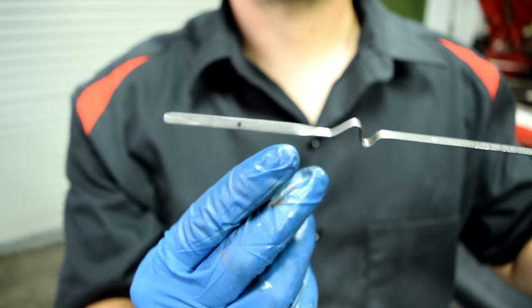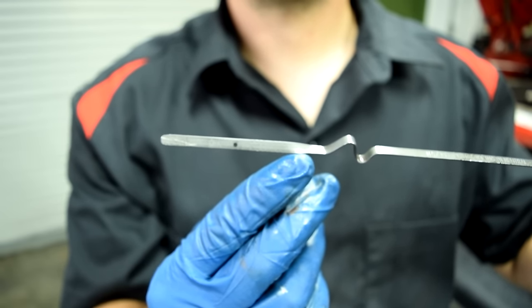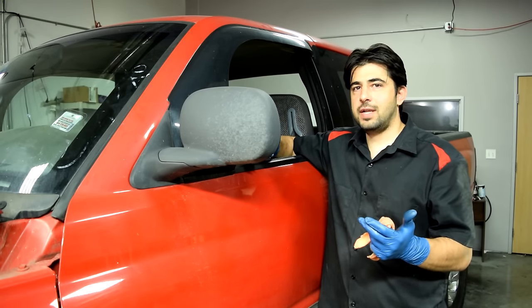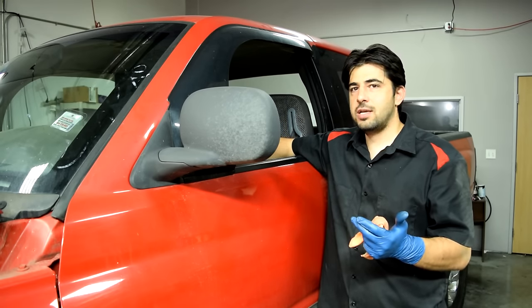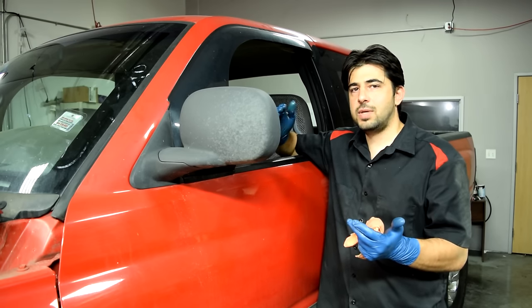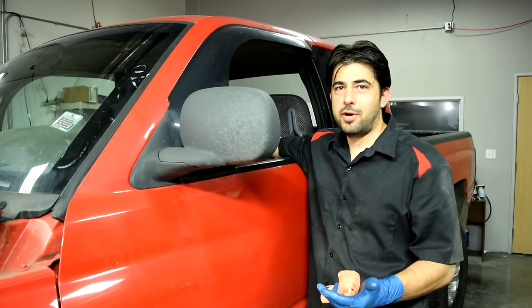All right, actually, here's a close-up shot of our dipstick. As you can see, here's the max fluid level. All right, so let's start her up. But I should say that you'll get a more accurate reading if after you start the engine, you put the transmission into different gears and wait 5 seconds between each gear. And then, of course, at the end, put it back in park.